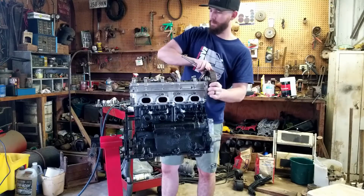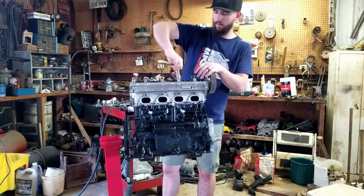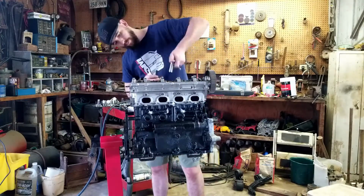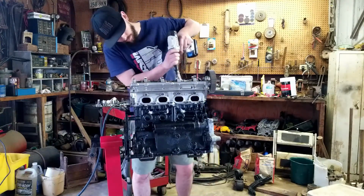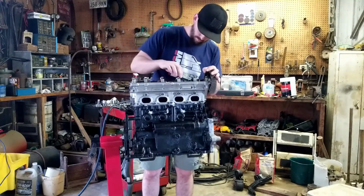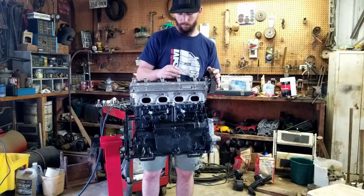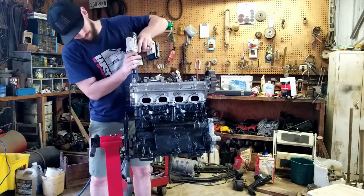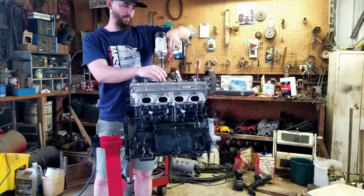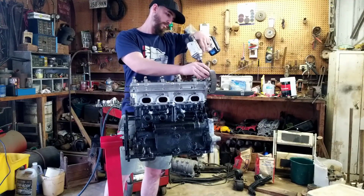So that's what we ended up figuring out, and right now I'm just snugging it down, and I realized that when the caps are completely loose and popped off, it spins freely, just like you would want a camshaft to do in a cylinder head that's not pressing down the valves. By the way, I'm testing all this without the lifters and roller rockers in it, because I need to see how well the cam spins. I tried it on each individual cam cap, and I found out that it doesn't matter which cam cap you tighten down, it starts to seize up the cam.